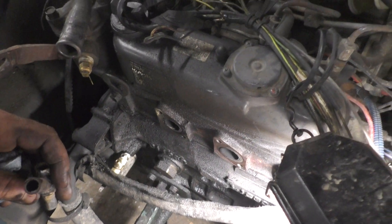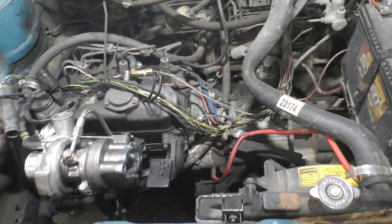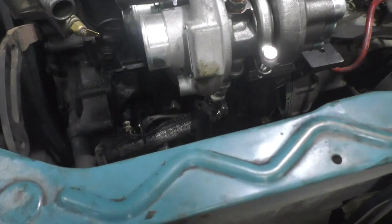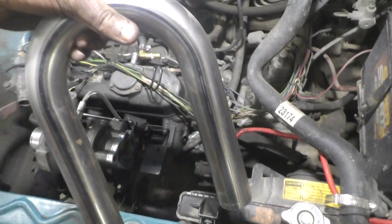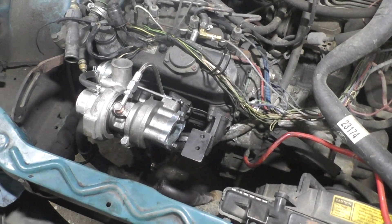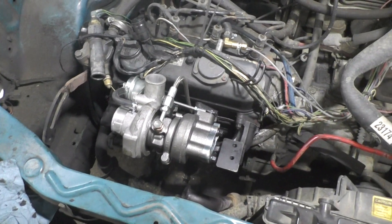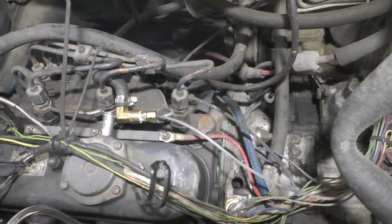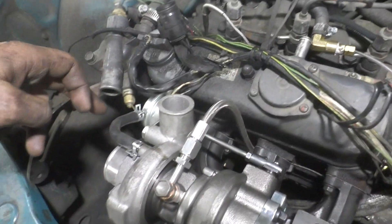The returns are cooling - we need to supply oil for the turbo, so we're going to take the pressure sensor right there and put a T in, put the sensor back out here, and then this will feed the turbo. I've got the T all in where the pressure sensor used to be. Now that this is cool enough I'm gonna drill down through here to make the hole, then we'll be able to put that back in. Should just be manifold, turbo piping - the turbo manifold bolts right up, turbo bolts right to it.